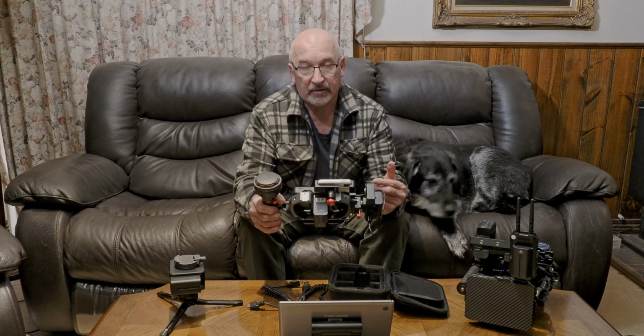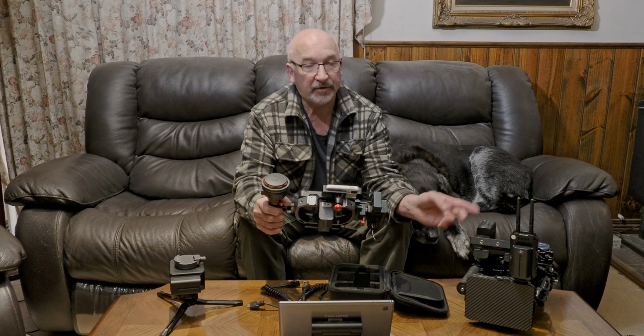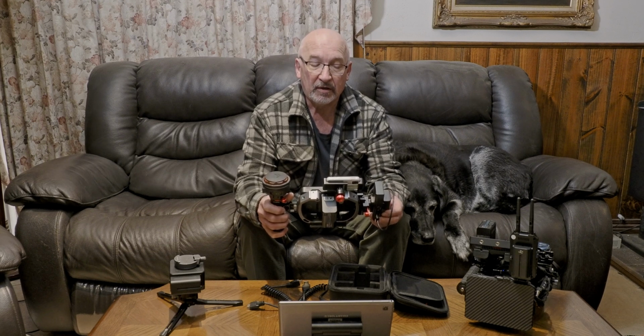And that goes from the microphone or the lav that you've got on you, that then is sent to the receiver on the camera. That goes from the receiver into the camera, from the camera to the camera monitor, then from the camera monitor to the transmitter to the receiver, and then finally back into the monitor itself on the handheld unit there. And so there's a lot of steps, and obviously there's delay occurring all the way through, so the latency there is probably, I'd say, 3 times longer than what it is with the visual latency on the monitor itself.